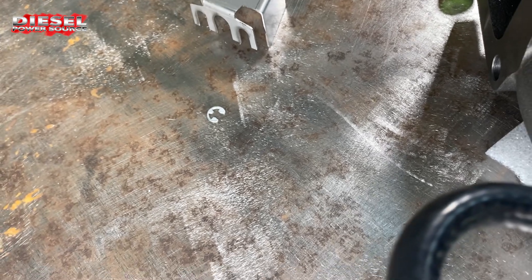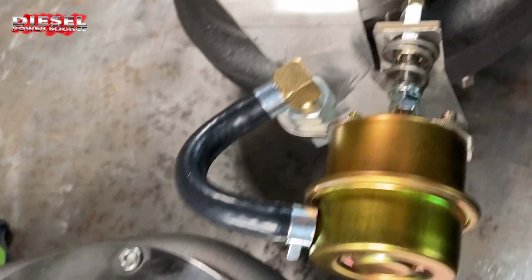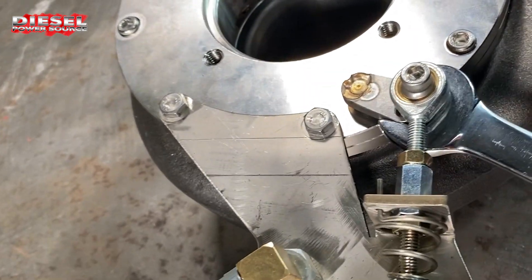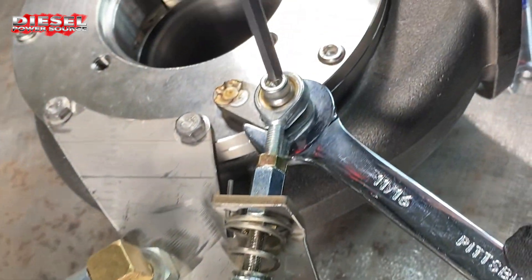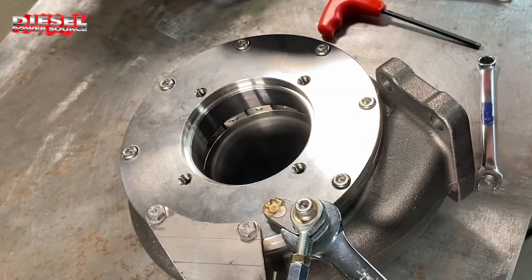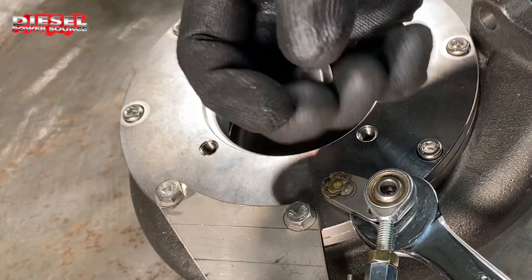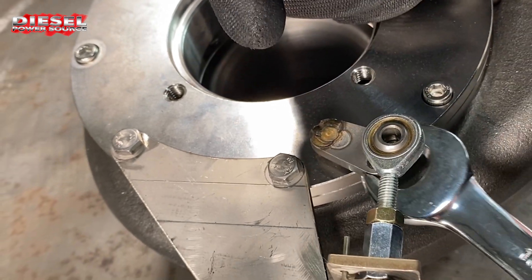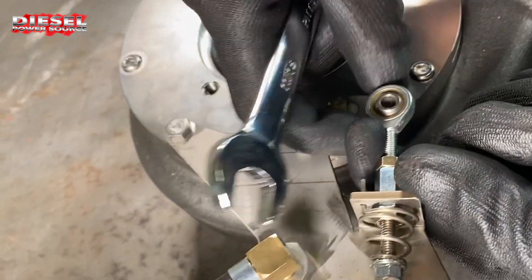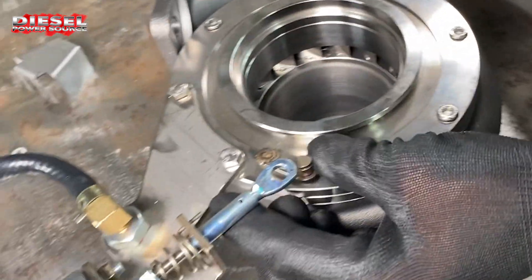If you're on this style, take an 11/16" wrench and you have to put the wrench here or you will damage this piece. On this one, you're simply going to put the wrench and loosen this bolt. This bolt does not need to be cranked too tight — maybe around 70 inch-pounds. Now that's free from the system.